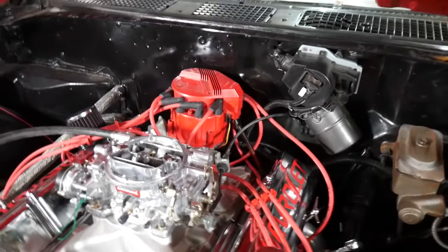And I got a flat screwdriver in here so I can get the idle up where I need her. Got my timing light. Got the vacuum advance plugged off for now. Guy's just going to try to get her warmed up. We'll dial her into about 18, see how she likes that. Let it get nice and warm. Then we can dial in the carb here.